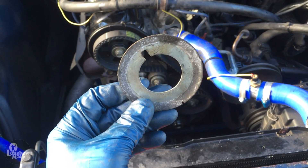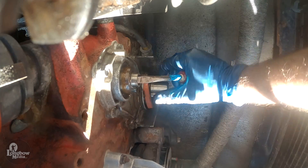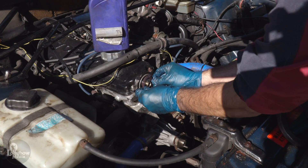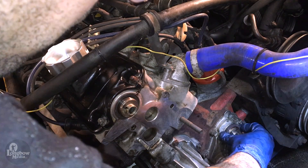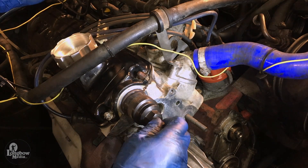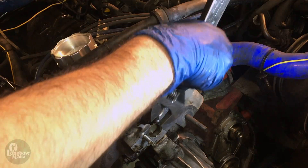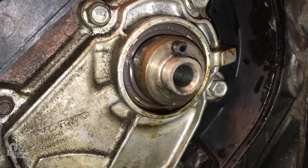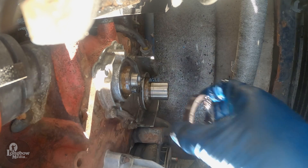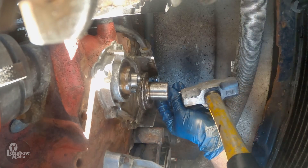Note the orientation of the washer — the curved side should be facing away from the gear. Remove all three seals by using a small standard screwdriver, gently prying on the inside edge of the seal. Take the two smaller, new, identical seals and lubricate the inside and outside edges, then gently place them on the camshaft and intermediate shafts. Use the smaller of the two drift tools to install by placing the drift over the seal and threading the drift screw into the shaft finger tight. Continue to tighten the drift with a wrench until the seal is sitting just below the chamfered edge. Inspect the seal for a rolled edge, which will cause a leak — the seal should look even all around the shaft. Lubricate and install the crankshaft seal, which is the larger of the three seals. If you don't have the appropriate tool for the larger seal, use a hammer and a punch to evenly seat the seal.